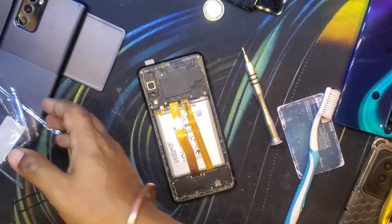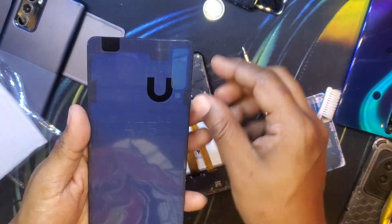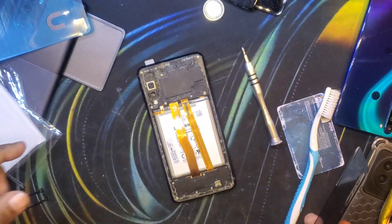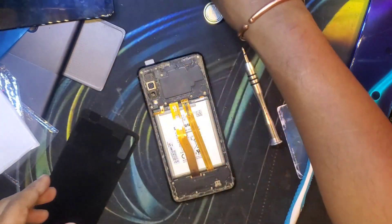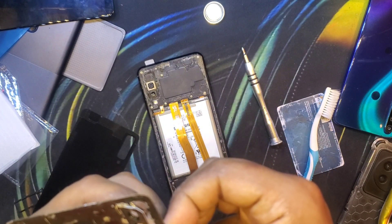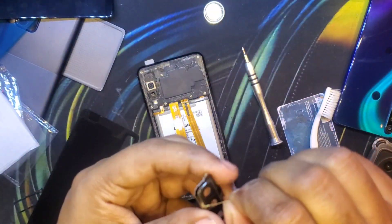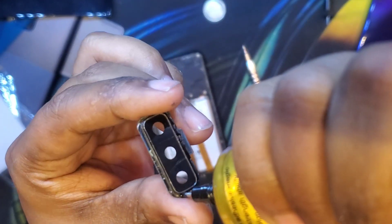The display part is done, and now it's time for the replacement back glass. I bought it in black, same as before. This is not an original or OEM back glass — these are reproduction items, and while they have pre-applied glue, I don't trust it so I use T7000 again. We need to salvage the camera glass from the previous broken back glass — it is also held on by glue. Simply pry it off carefully so you don't get cut by any shards from the broken glass.